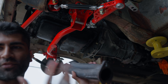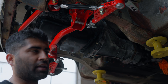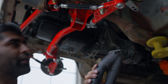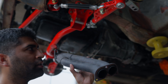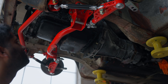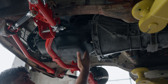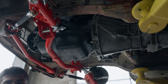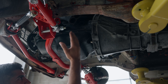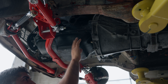We figured modifying only the mid-pipe was the path of least resistance for guys running the L-series. If you have a right-hand drive vehicle, this doesn't affect you. If you're running an SR20, KA swap, or other popular engine swap, it also doesn't affect you since you're likely running custom headers or exhaust anyway. The steering rack sneaks right in between the engine and the chassis, and if you're running the factory engine with the rear sump, it's just the mid-pipe you have to modify — you can keep the oil pan and transmission as-is. For SR20 or KA swaps with a front sump pan, the crossmember is reversible and gives you even more room.